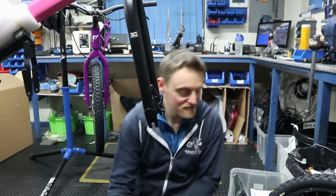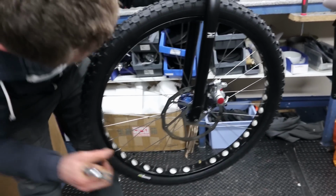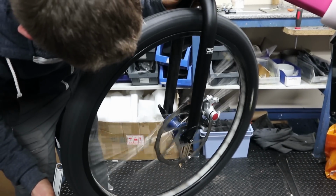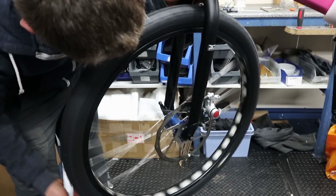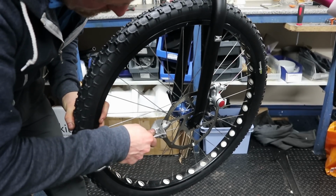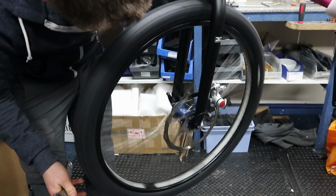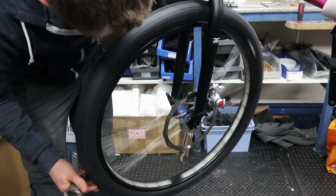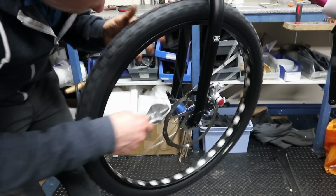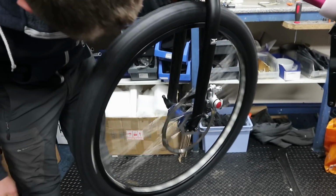So. Yeah. A couple of battle scars, there's one just there where it's been smashed on a wall, a bit of brick dust still in it, so learning to do this is worth doing. Even if you've got a really knackered old rotor, just bolt it onto a hub or a wheel and have a go at straightening it, and if it gets better, then happy days. You learn something, and you can possibly even do it out in the field. If you've got a little adjustable spanner, it helps you get home with a working brake.